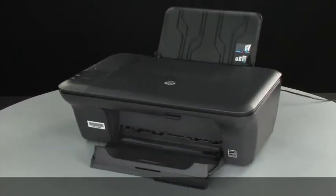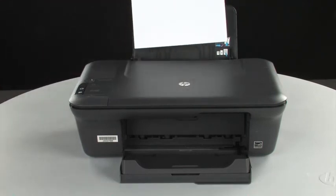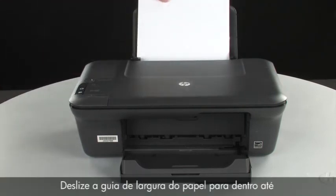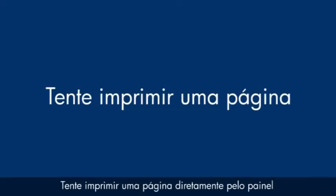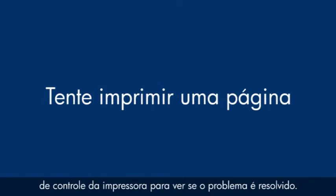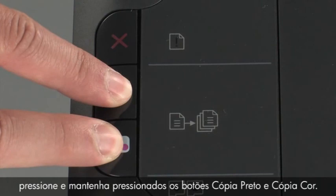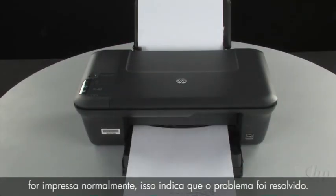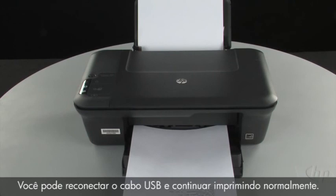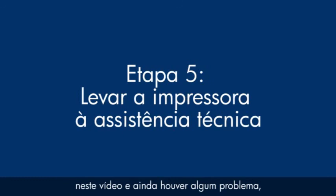Move back to the front. If the printer does not automatically turn on, press the power button on the control panel. Load paper into the input tray until it stops. Slide the paper width guide inward until it stops at the edge of the paper — do not push it so tightly that it bends the paper. Try printing a page from the printer's control panel by pressing and holding the black and color copy buttons, then releasing both at the same time. If the page prints successfully, the issue is resolved and you can reconnect the USB cable and resume printing as normal. If the page does not print, go on to the next step.